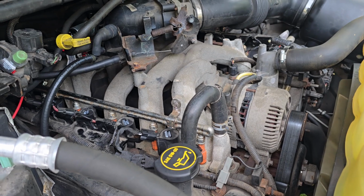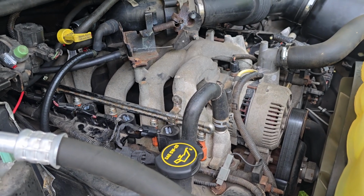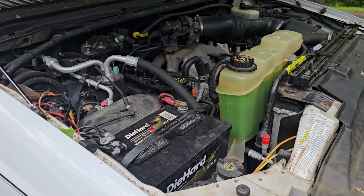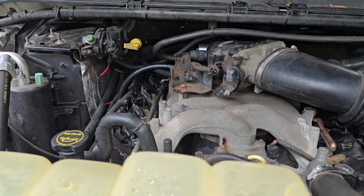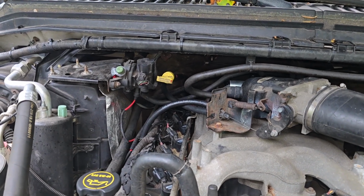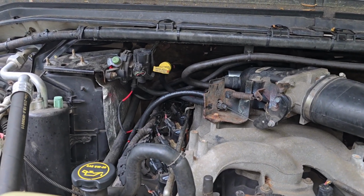Unfortunately, while I had it off, I did a slight test drive just to find out that the performance was there, but the misfire was still there. So we restored the performance from the sluggishness, but we still have this misfire that we're chasing. So I've done everything that's common, and I didn't really prepare to do this video, so I apologize for the bad storytelling. But as you can see here, I put a new hose on. Everyone goes, oh, the PCV elbow is the biggest thing that goes. Well, we already replaced that anyway. Went ahead and put a new hose on.